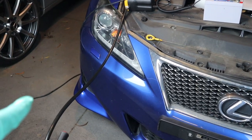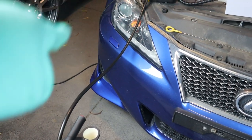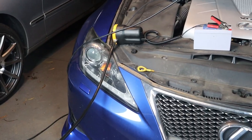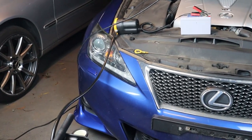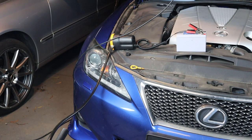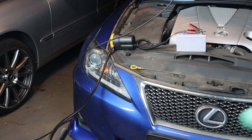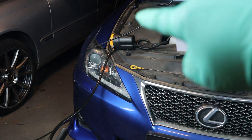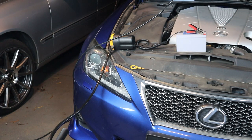There's a reason why I've chosen to give it a little bit of pull, so that once it pulls the oil out of the engine it simply rushes straight into the oil canister. We're going to leave this for about 15 minutes. Another thing about doing it this way is that you don't have to bother about removing any of the covers. All you have to worry about is simply getting your tube from your oil extractor pump down the dipstick, because dipsticks pretty much go to the oil pan of the engine. If you get it far enough in there, it's basically going to take out all the oil.